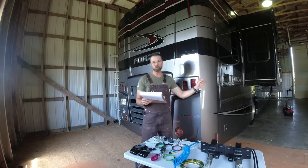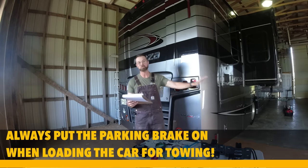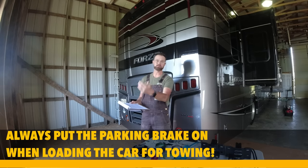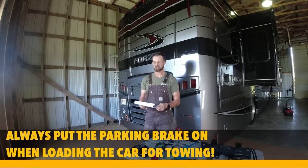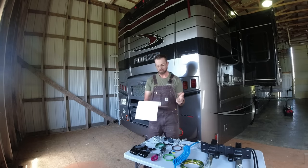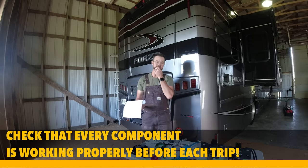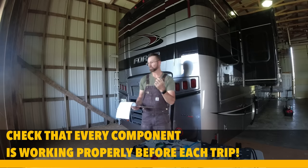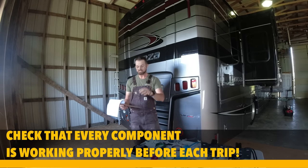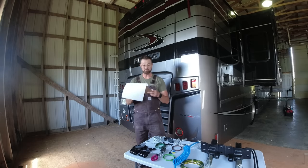When you are loading your car, always put your parking brake on because you will put the vehicle into neutral. If you're putting the vehicle into neutral, you've got to put the parking brake on — the minute you put it into neutral, the car is going to roll away. Every time you tow, make sure you check the hitch and make sure everything is working properly. We use walkie-talkies — my wife will get out and do the full safety inspection, or I will. We've made mistakes in the past, so the key is to avoid them by using a checklist.